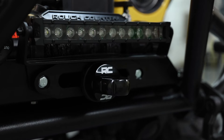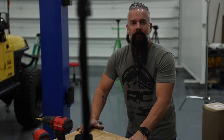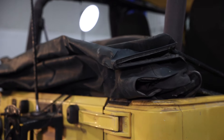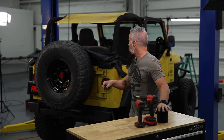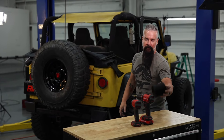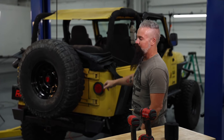Alright, we are getting really close to finalizing this rebuild. Next up, we're going to move to the soft top replacement. We're going to get the old top off. We're going to replace the webbing that connects the back bow with the center bow — I was able to pick this up off Amazon. We'll get this top off. We'll get the new top laid out in the sun so it gets nice and soft and it's easy to install. First step, removing the old top.